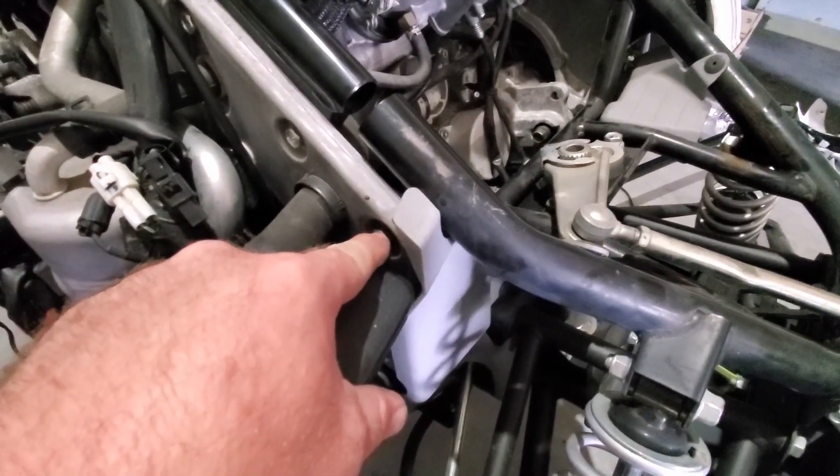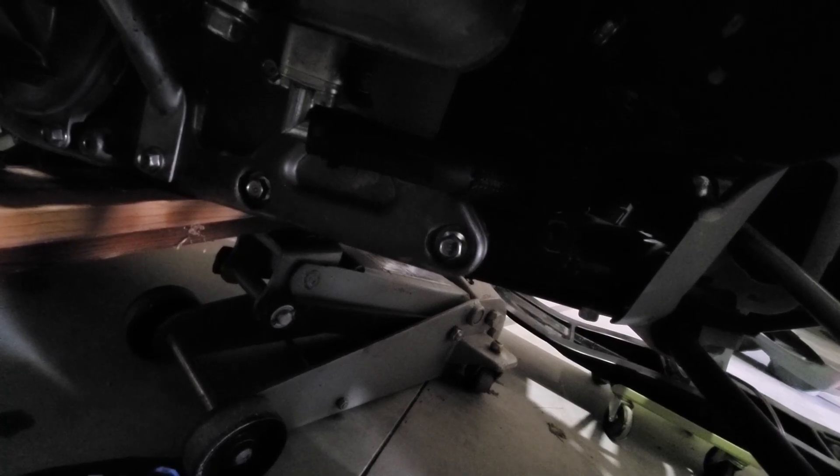So there is a bolt here, a bolt right here, a bolt here, and here — these are on the right hand side of the sled. Then you need to drain the oil out of the oil tank and remove this hose right here, which is going to have some residual oil in it, so you want to make sure you have something underneath to catch that when it comes out.